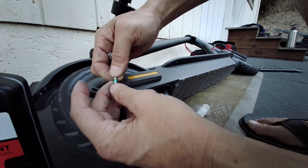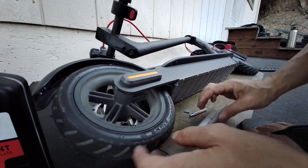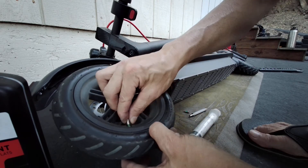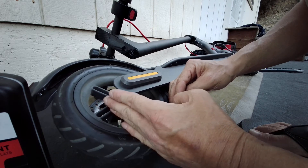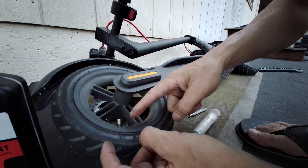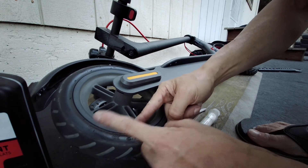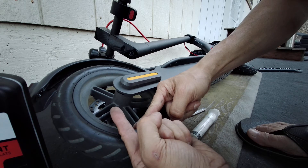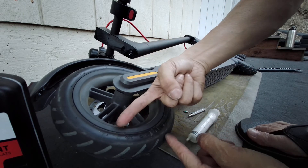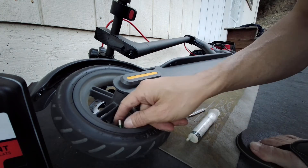Valve core — it's pretty clean. This valve is not quite square, it's kind of angled, but actually having an angle this way is okay. Having it angled clockwise is okay because if you lock up the brakes and the tire slips — if the tire is kind of under-inflated — the tire will slip that way. Since the valve core is angled this direction, it will move this direction so it doesn't get harmed. But if it's already facing the other direction and it slips, it's gonna rip at the base of the stem. So this angle is actually okay.